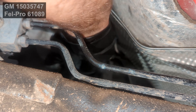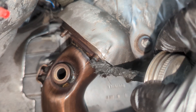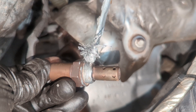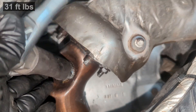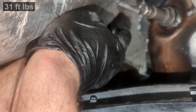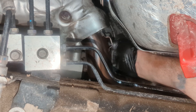Back on with the exhaust — push it back up into place. I'm hitting the studs with a little bit of anti-seize because exhaust manifold bolts can be really difficult, and if this eases the process next time I'm happy to do it. I'm putting a little on the oxygen sensors for the same reason, then twisting the harness counterclockwise a number of times so that as I rotate the sensor in, it untwists the harness with no stress or strain. Tighten those up — calls for 31 foot-pounds, a difficult place for a torque wrench, so I'm doing what feels tight enough without being crazy tight.